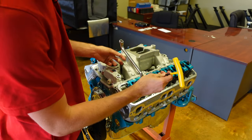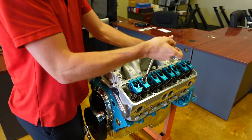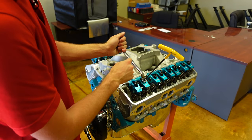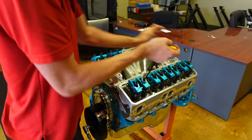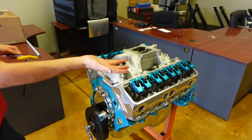If this engine had a 7/16 stud, or maybe we had a different type of lifter, then that preload would be different. So again, I gave it the one turn rotation, I'm going to screw this Allen key down, give it a little snug, and then lock it all together. You'll feel it hit that wall — at that point, you're done.